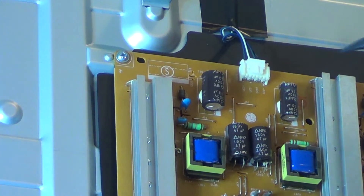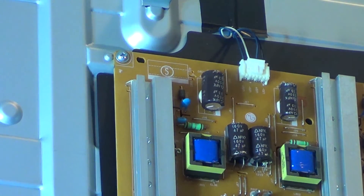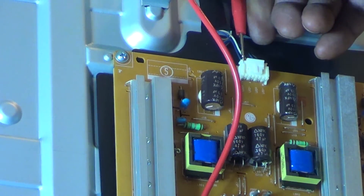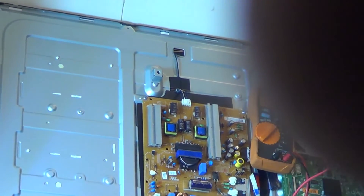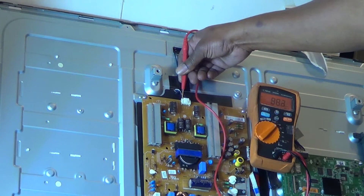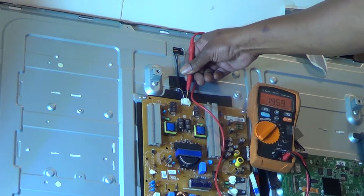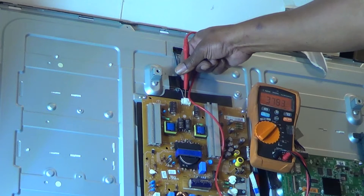They are marked on top: LED plus, LED minus. This is for you guys that don't have an LED checker. The positive is the blue wires — LED plus. I'll check my first line — it's reading approximately 88 volts. And I'll go to my other LED plus line, and it's reading 130 to 140 — it's jumping around. So that is most likely our bad line with the bad LED on it.